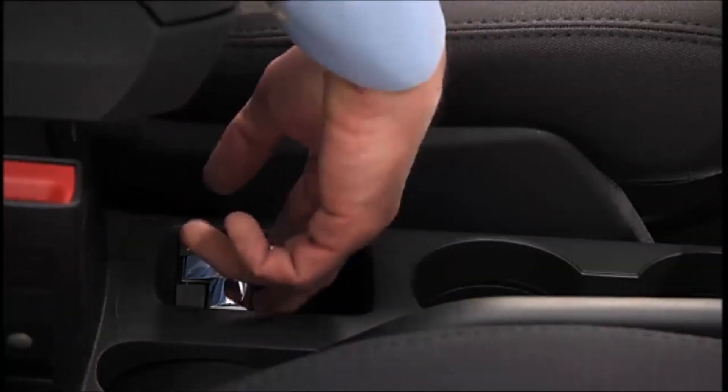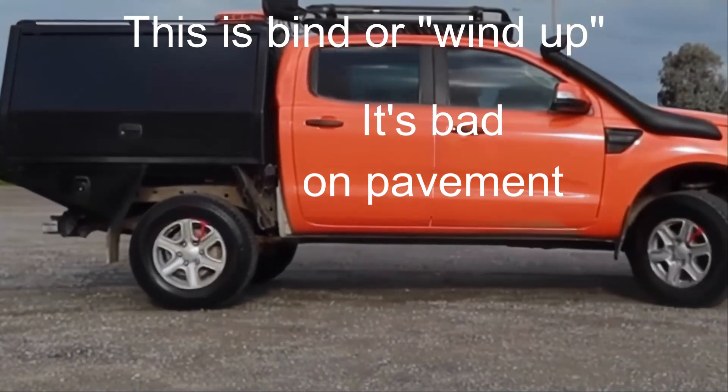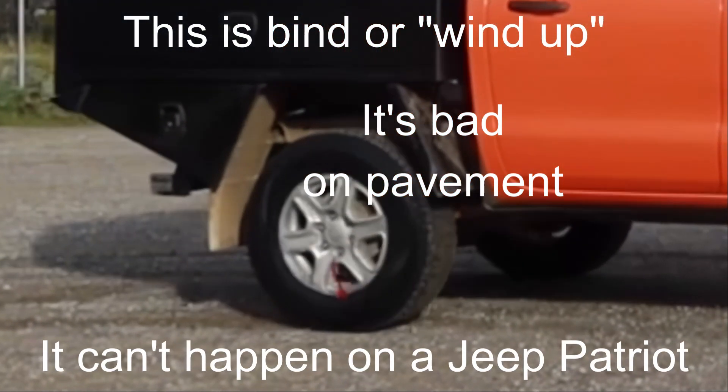This is kind of to pay homage to older traditional four-wheel drive systems. It's not really a lever — it's just a push button that sends a command to the PCM. Whenever you pull that up, it lights up the four-wheel drive indicator in your dashboard and tells it to keep the clutch engaged continually. However, unlike a conventional four-wheel drive system, it still automatically turns off above 35 miles per hour and turns back on again below 35. Also, since it knows when you're going around corners, it pulses the clutch to relieve driveline bind, so you don't end up crab walking or causing undue wear. That means you could hypothetically leave it in four-wheel drive mode all the time and not cause any harm.